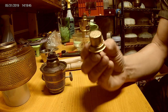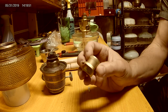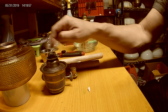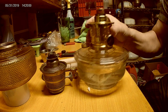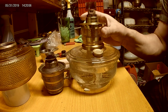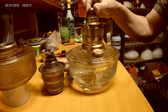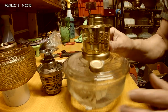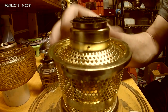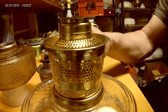There are a hundred different wick cleaners and they all do the same job - they're all interchangeable. It just gives the wick a nice contour so you get a nice burn. So what I'm going to do on this Max Bright 500 is trim the wick, because this lamp did over-burn on me a couple of times. I don't want to pull it all apart and change the wick, so I'm just going to trim it. You can see it's definitely uneven - not a nice consistent wick.